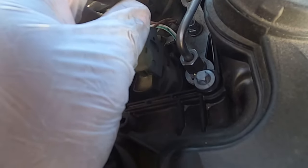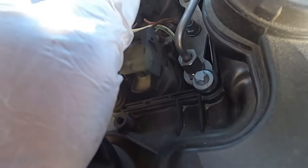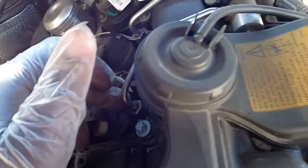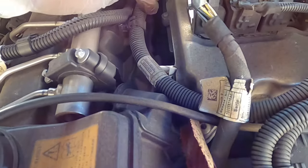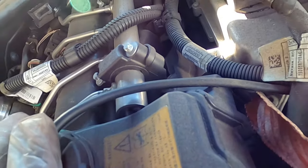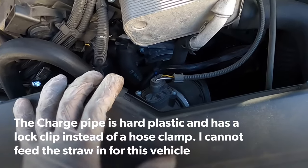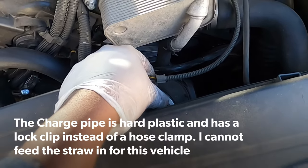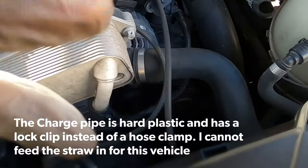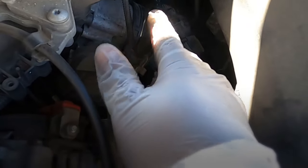This can cost thousands of dollars to get your intake valves walnut blasted at a dealership. These are where the injectors are. If your car has port injection, they would usually be somewhere around here near the intake manifold spraying that gas into the ports. Our issue is our intake area is right here, but this is for our turbocharger — we cannot put our intake valve cleaner through here. Our throttle body is actually right here, but the problem is this is a charge pipe that handles boost pressure, meaning I can't actually take that off.